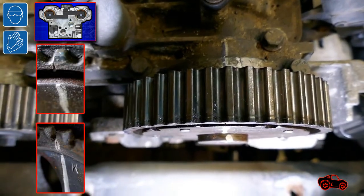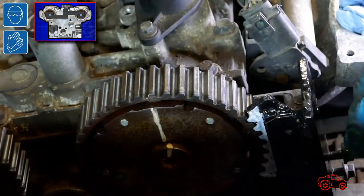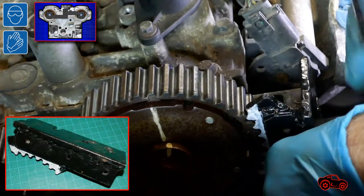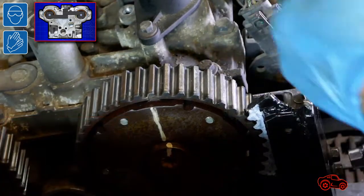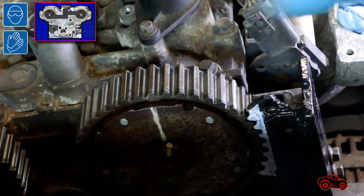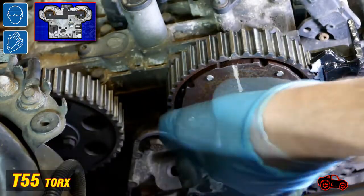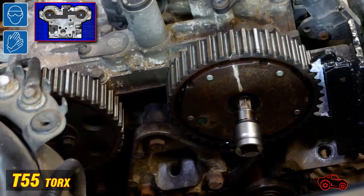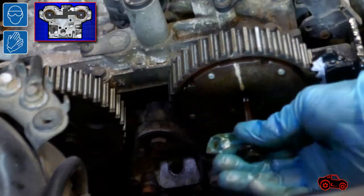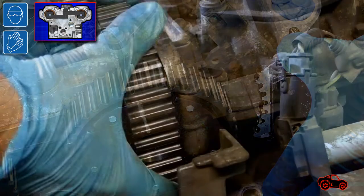These are timing notches on the side of the sprockets and all timing marks I made in 2015. I removed the front engine lift bracket and I installed my homemade sprocket locking tool. This locking tool is not required to undo or tighten the cam phaser bolt or the phaser plug, but it's very efficient and useful. I used a T55 Torx bit to undo the plug and also to undo the cam phaser center bolt. After, I removed the sprocket locking tool and the VVT sprocket.